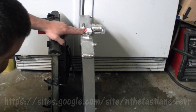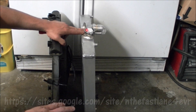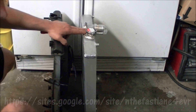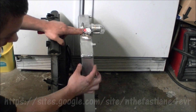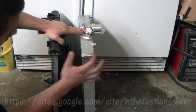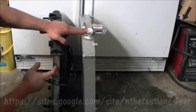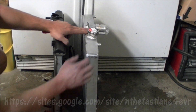I have a three-inch downpipe on my turbo setup — I have a turbo GSR — and that's why I needed to switch to a dual core radiator because it just couldn't handle it. I'm glad it's actually going to fit because I was hoping it didn't get any wider than the original. All they did was put the core right in the middle on the single core, and on this one they just put two side by side, so it fills the whole space.